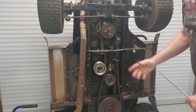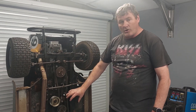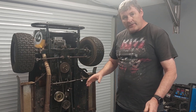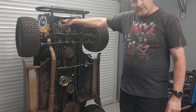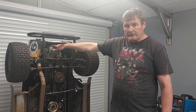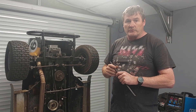What I try to do with mowers running Peerless gearboxes and right angle drives is go for a two-to-one ratio underneath. You can change them depending on what sort of speed you end up with, but I generally go two-to-one. Remember this is a single cylinder - singles don't rev as well as a V-twin. A V-twin you generally want to rev the engine more. The singles have more torque; the twins rev up quicker but haven't got as much low-down torque.